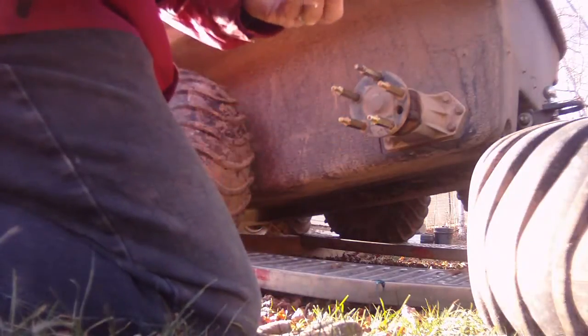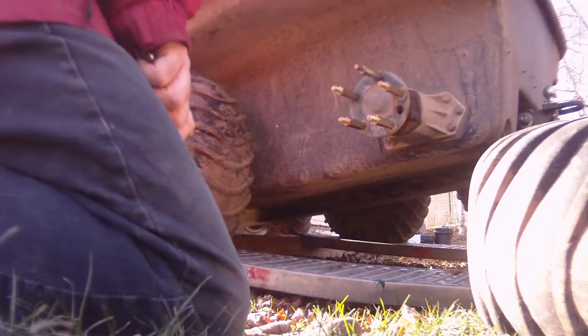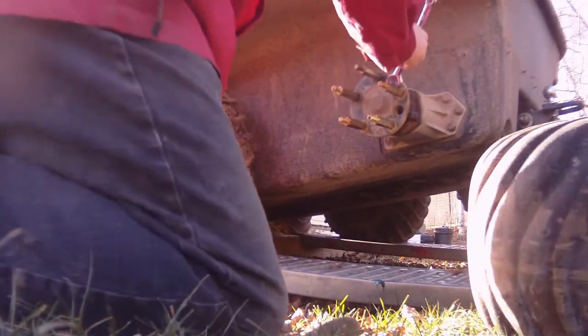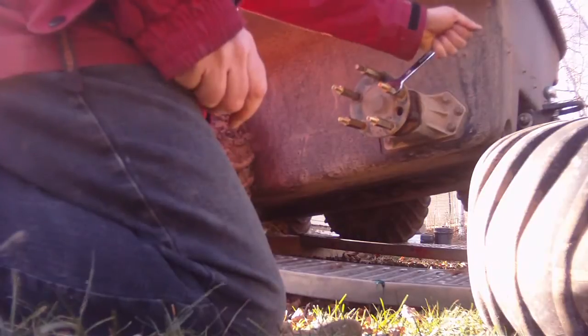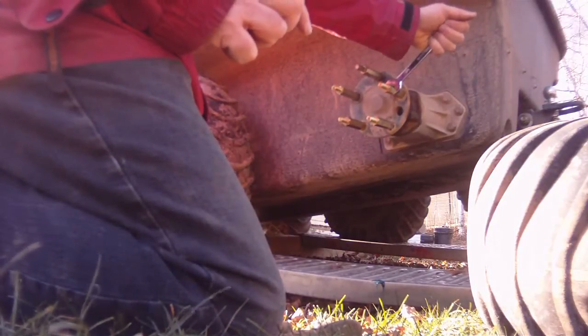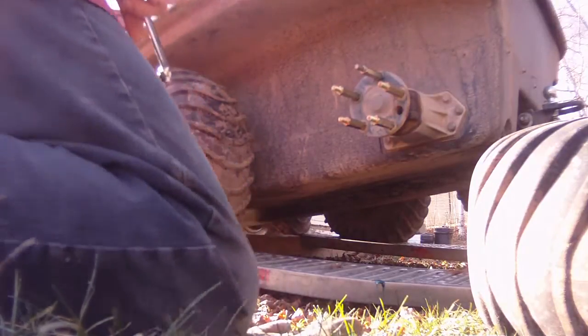Here's your wheel nut. Actually, no, 5/8 won't fit your wheel nut. Sorry about that. You probably want an 11/16 for your wheel nut. 5/8 works good on the extensions. You put these extensions on, don't torque them right down. They're on, that's it. The reason for that is you have to adjust them. When you get them adjusted, your spacer will slide on quite easily.